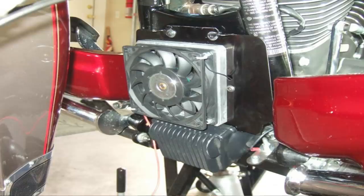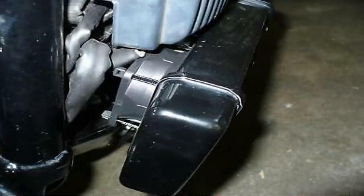We can take it a step further with a fan-assisted oil cooler. I love fan-assisted oil coolers because they're thermostatically controlled and operate the same way as non-fan-assisted units with a thermostat. But with a fan-assisted cooler, they allow the oil to reach a little higher temperature before the fan kicks on — usually about 210 degrees. They then run to maintain oil temperature at about 210 to 230 degrees.